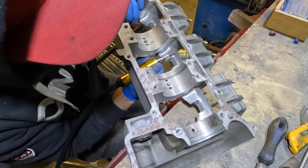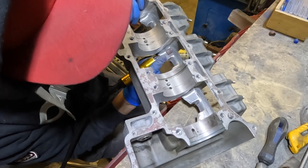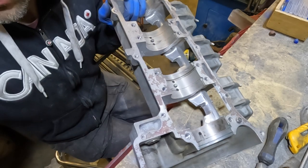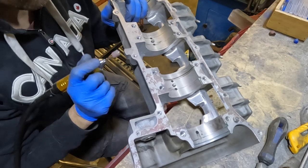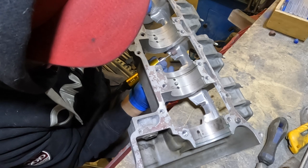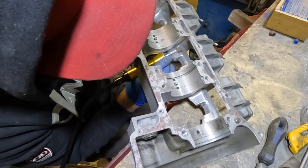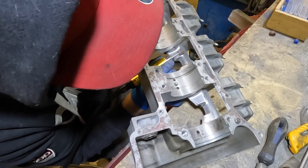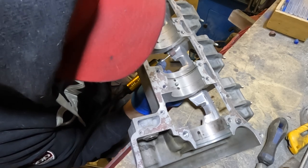But when I come over here, because it's rotating clockwise, it's trying to push me out of the corner. So what I can do with the Vevor rotary flex shaft tool is actually reverse the direction, and that will pull the sanding drum into the corner and make this grind way easier and way more consistent.